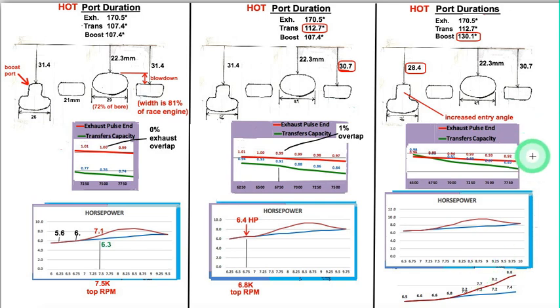Now we've got the third porting. This larger graph gives the details of what the horsepower is for each RPM section. Instead of 6.4 horsepower at 6.8K, this has 6.6 horsepower — so you've got more than enough. The only question is whether this angle, with 14 degrees being about like that, can get past this section and allow the engine to accelerate on up. So the question on the third porting is whether or not that angle is at least 14 degrees. I'll find out soon — probably tomorrow I'll be able to put it back together and ride it after getting the frame welded.